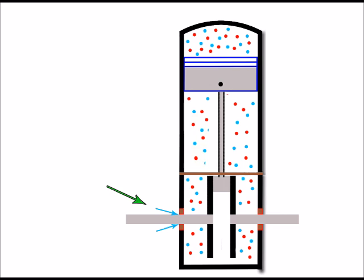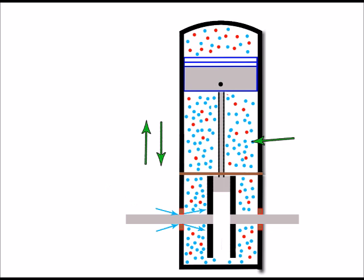And if those seals aren't working correctly, or they're damaged in any way, it can draw air into the crankcase there. And of course, we know what that's going to do. It's going to mess around with that special fuel-air mixture. There's going to end up being too much air to fuel, and it's going to weaken the mixture. As the piston reciprocates, we're going to get more and more air coming through.